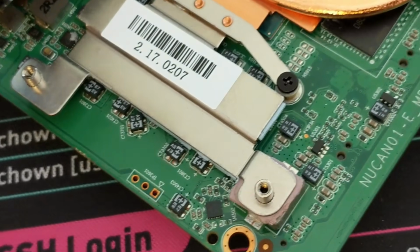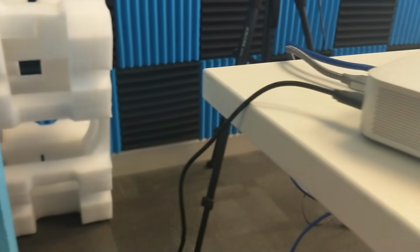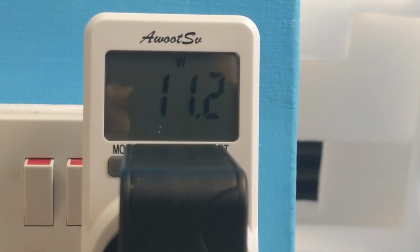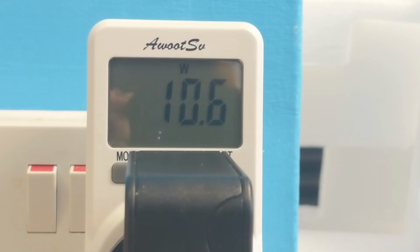When we had the system running, for example, if we go straight into power utilization, that N100 CPU quad core, that's 4 efficient cores, 4 thread CPU, goes up to a maximum 3.4 gigahertz, but its base level performance, I believe, is either 800 megahertz or even 1 gigahertz. It only scales up when it needs to. Consequently, the TDP on that CPU is rated at 6 watt.